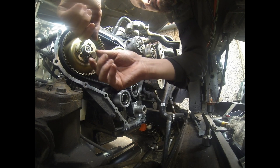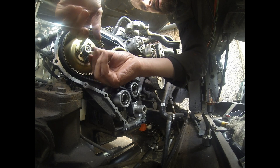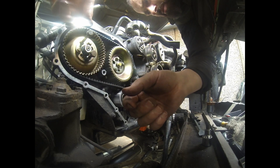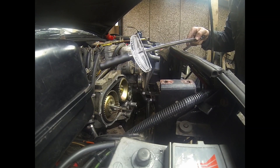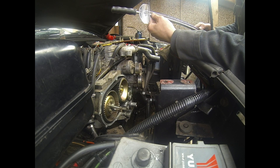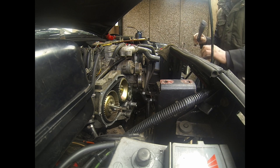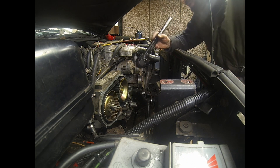The idea is to leave these loose while you tension it up, because it gives that bit of movement but it holds the pump in the timing position. So if you tighten that up, about 10 to 12 pounds a foot. And torque a bolt is 45 Newton meters.